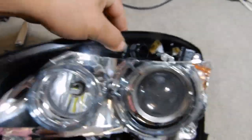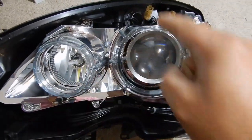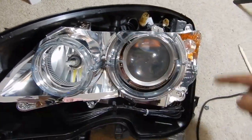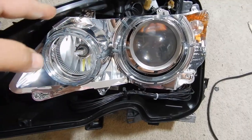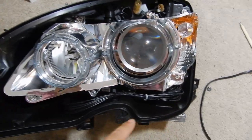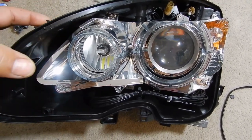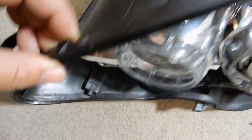And you are done. Lastly, make sure we clean all of this with some microfiber cloth. Do not wipe too hard as you may scratch it. Get an air blower and blow everything out just in case you have some dust in here. The last thing we need to do is put some d-mastic sealant all in here — just a nice thin line, a good amount so that it creates a really tight seal. Heat it up for a bit so it can spread evenly, push it in, clamp it down, grab your four clips and clip them back on.